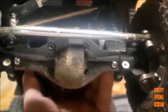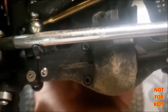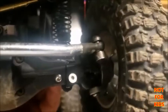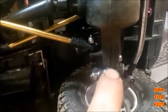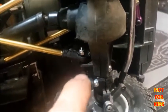The front axle had been narrowed probably an inch total, probably a half inch on each side. And how I done that, I took a SCX10-2 axle and cut them at the pumpkin, and then more or less just cleaned the axle up, and used them like you would a beef tube to make the narrow front end. And if you look, I cut on the inside of this link, where the link and shock bolt to this housing, and that's how far I got it moved in. Then cut axles and flatten out the 2 places for the center chunk.